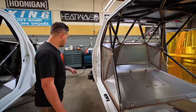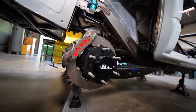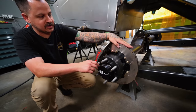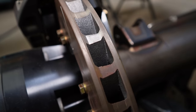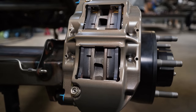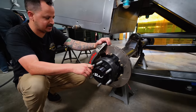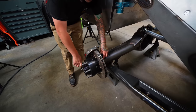Since we're talking about brakes, might as well show you the Brembos — I think we showed those to you a couple weeks ago. We got them here mounted on the TubeWorks rear end. These are Pro-Am trophy truck hubs — a three-and-a-quarter trophy truck hub — and it also runs a 14-inch inch-and-a-quarter rotor. These are big bad boy trophy truck Brembo monoblock one-piece calipers — pretty much the baddest of the baddest when it comes to braking. This guy wanted to run all the good parts, so we went ahead and ordered these up. They actually worked on our caliper mounts that we already make.